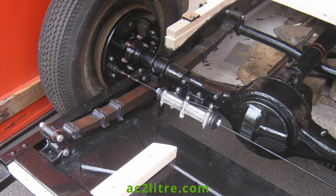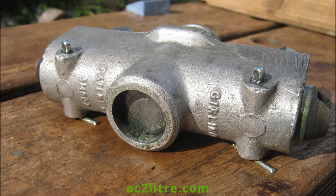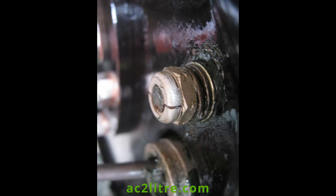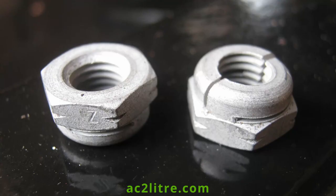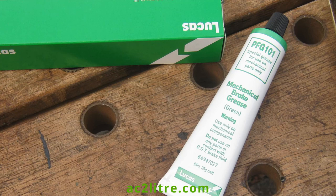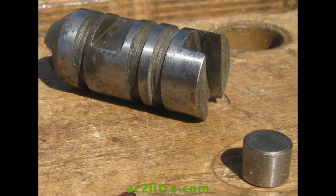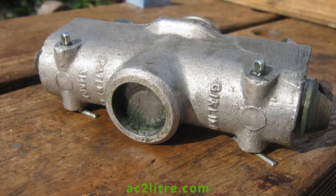The rear mechanical brakes require some specialist knowledge. The expander floats on the back plate; there are slotted mounting holes and the two nuts must not be fully tightened. There's a double coil spring washer under each nut. As the studs are a bit short, I had to order special thin self-locking nuts from LAS Aero. I used green mechanical brake grease under the expansion unit. If the expander cannot float, the braking force is greatly reduced. I used that same green grease inside the expanders and adjusters, which I dismantled and cleaned.